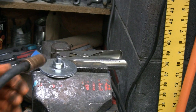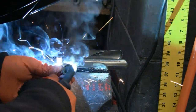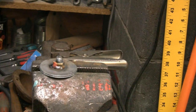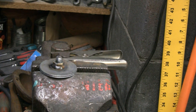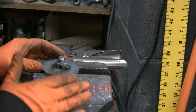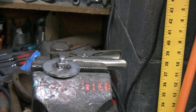Let's go inside and do some work. I'll grind the zinc off for that — make it easier to weld. Sometimes when you weld through the zinc, it doesn't get a good adhesion. Alright, let's try this again.